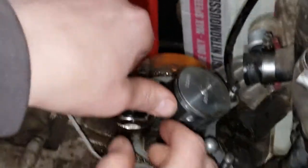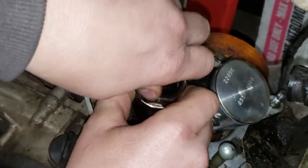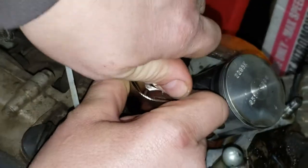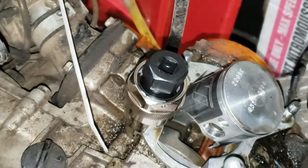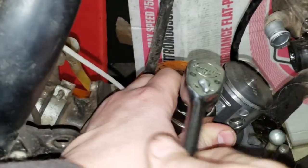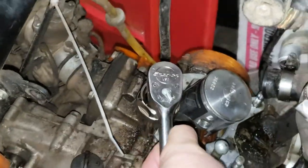Put this guy on and tighten it up. I've used different kinds of stud extractors — this one seems a little more compact. The more I work to loosen it, the tighter it gets on the stud. I torched them and hit them with some penetrating solvent, so hopefully any Loctite has broke loose. I think we've got it locked on there now.